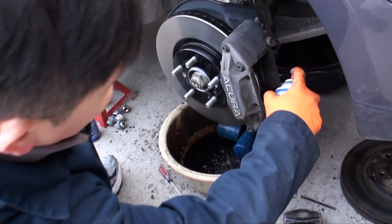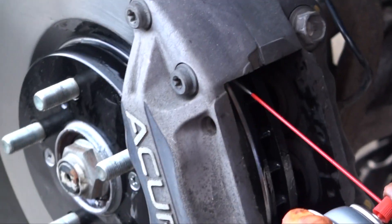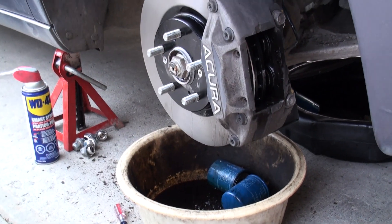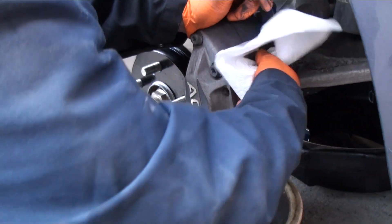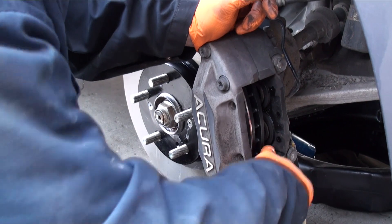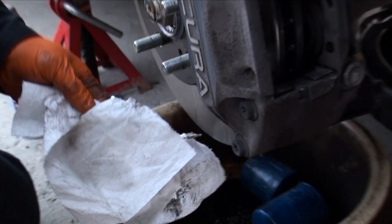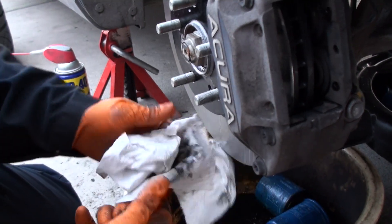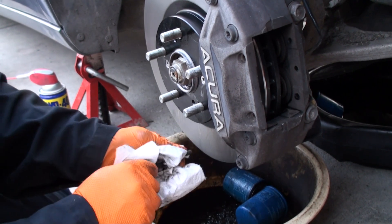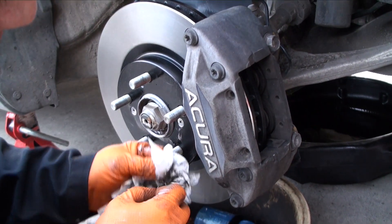We want to take some brake cleaner and spray the inside sliding surfaces of our caliper body, located here, here, and on the top surfaces in there. You can feel free to spray down the insides of the body to reduce any brake dust collecting on the inside surfaces of that caliper body. Wipe down the sliding surfaces of the caliper body — the key thing is to make sure that there's no excessive buildup of any lubricants that any previous service technicians may have used. Next, spray some brake cleaner on a rag and clean our spring clips as well as slider pins of any excess residue. Make sure that the slider pins are nice and smooth and don't show any excessive signs of corrosion, which could hinder the pads' ability to slide along the pin. Last but not least, clean the retaining spring clip.